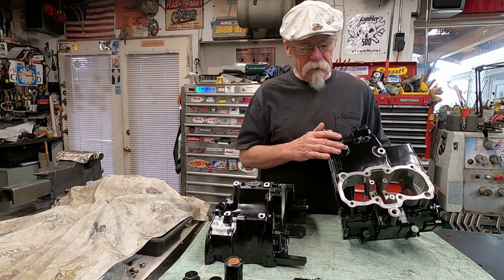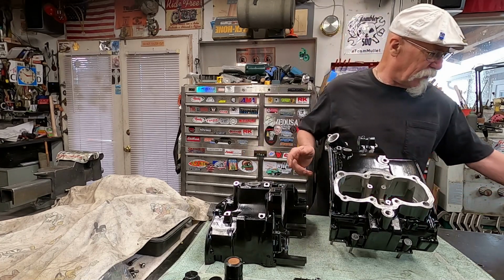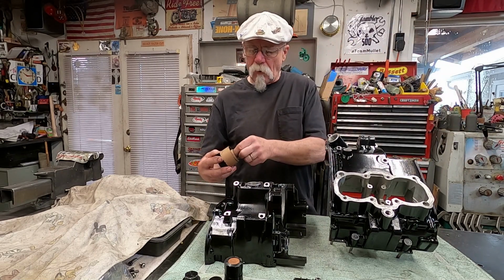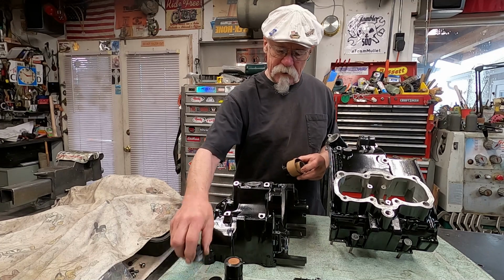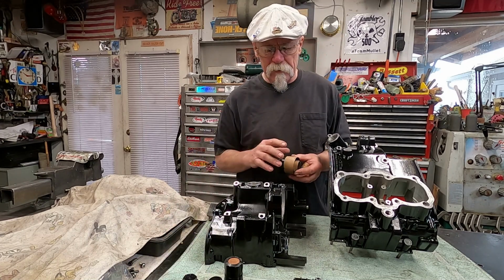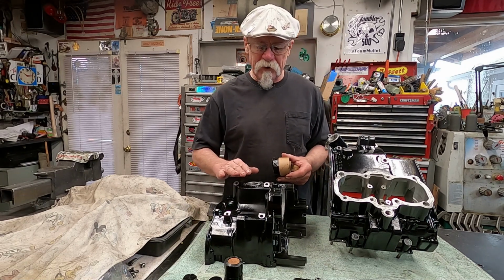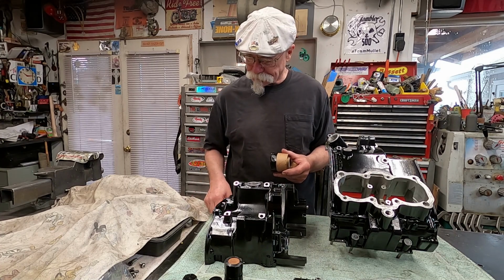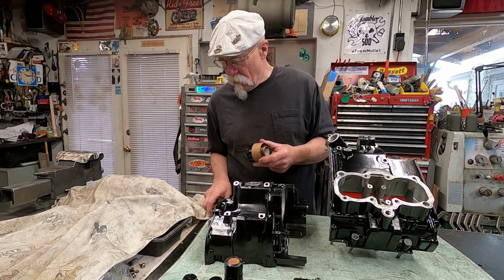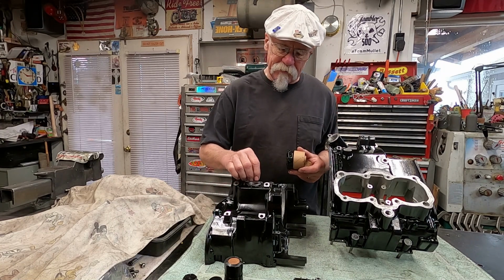Now what I ended up doing is that I sprayed these cases. I taped off a bunch of it. I used little items like this that I made up for plugging the holes on the drain parts. I literally just put the plugs in and painted them in place. Now if you wait an hour or so after it sets a bit, you can come back with either some fine sandpaper or a little razor knife, like this, and clean these areas up.